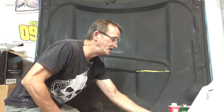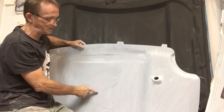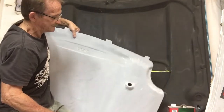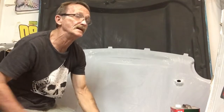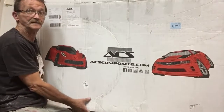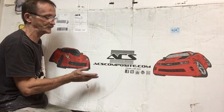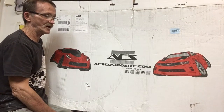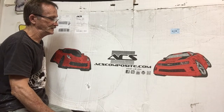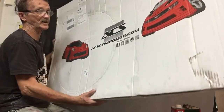There are also aftermarket paintable hood liners. This one is for a Camaro — it's fiberglass, comes primed. You 320-sand it and clean it with prep solv and it's ready to paint. This one was made by a company — I'll show you the box so you can get the dot-com off of it. They make different hood liners for different model cars. For people doing car shows it's well worth purchasing one of these rather than using the felt hood liner that's already in there. This fiberglass hood liner comes primed and ready to go.